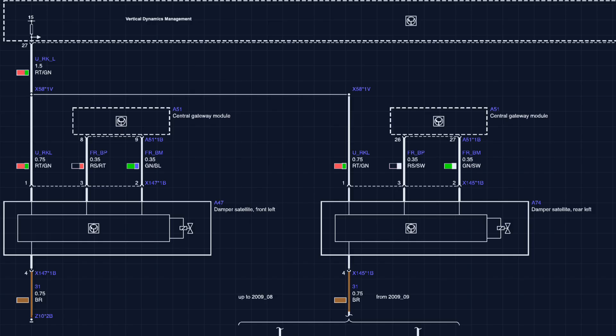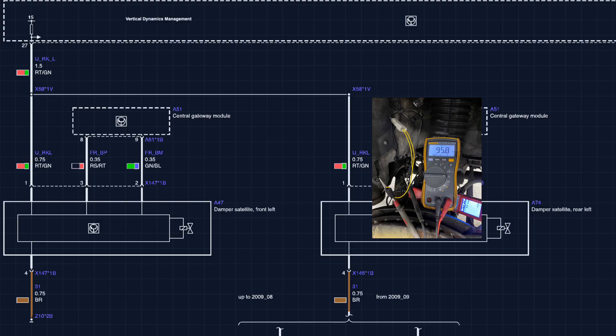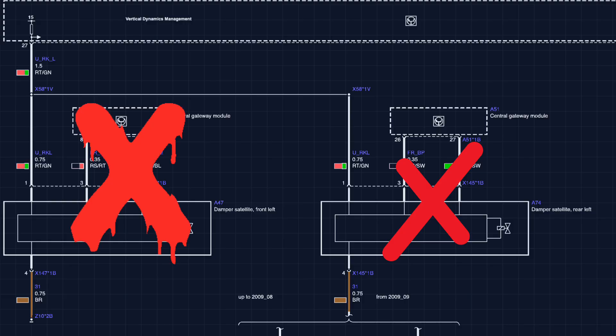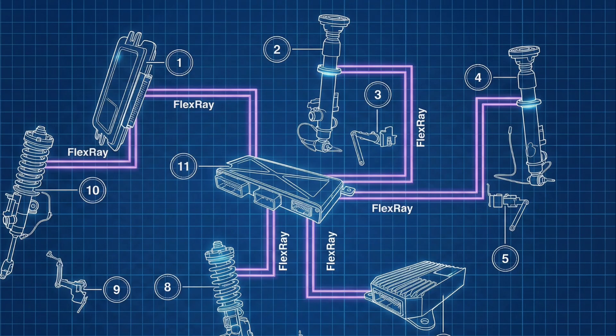It's quite simple. You've got a terminating resistor in the rear left and it's paired to the front left. You need both suspension system terminating resistors intact, otherwise you'll lose comms on the whole line. If you have no resistor on either end of path five, you're going to end up with a massive signal reflection that's going to kill your front one as well. So essentially, just by disconnecting the rear left damper electrical connector, you've taken out the 95-ohm resistor housed in the EDC suspension control unit, killing the entire path.